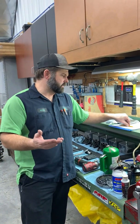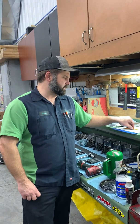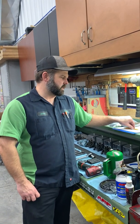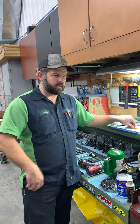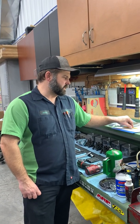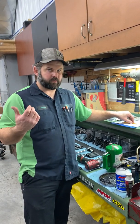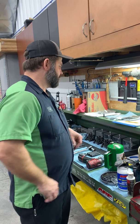So you're putting in a big cam, and by advancing it that 1 degree, you're probably realistically not going to notice a difference, but on a dyno you would see your power band move down a little bit. That's what most people are going to want. So 98 degrees, we're going to stick with that, and we're going to check our valve to piston. As long as we're good on valve to piston, we're fine.